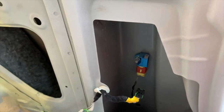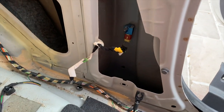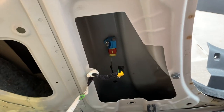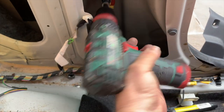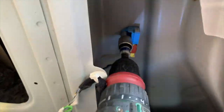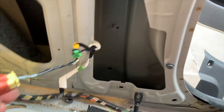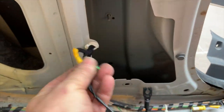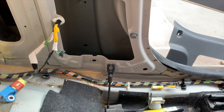So that is about it. There's a 10mm bolt on that which you can just undo. We'll do that now with a drill with a 10mm bit on it. Quite tight — there we go. So I can keep that bit. Even though someone has done something to that, I don't quite know how they've got around that — it's really weird.